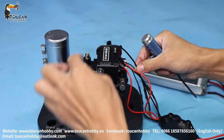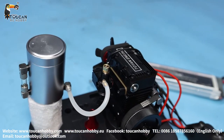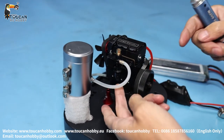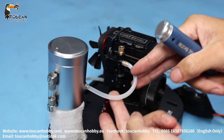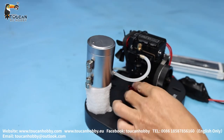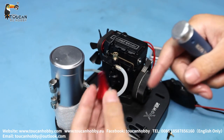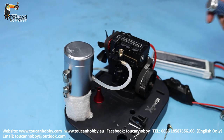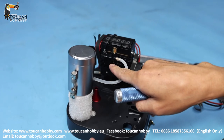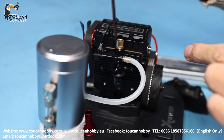The negative line wire is here. Here is the connection. And this side, this one is the carburetor. This carburetor and the suction oil line — this oil tank inside is the methanol. You can plug it in, but if too much vibration it will come off, so I'll take it off. If you want to secure it, I can put a little glue. So here is the air suction, and the air goes inside, mixes with the oil, then goes to two-cylinder, two-channel, into the two cylinders.